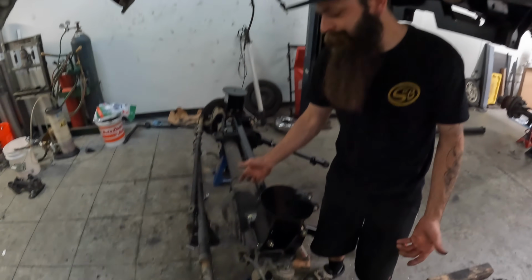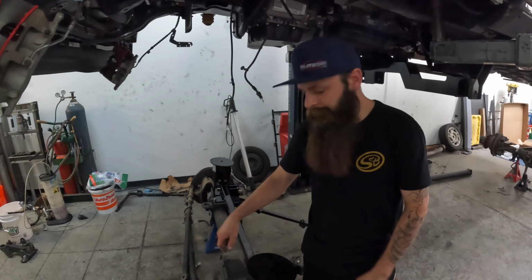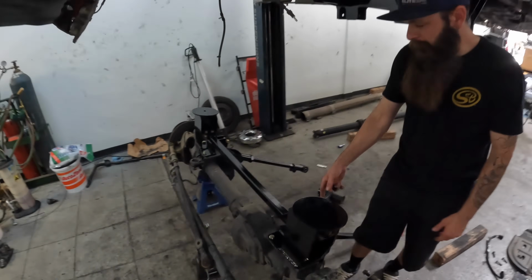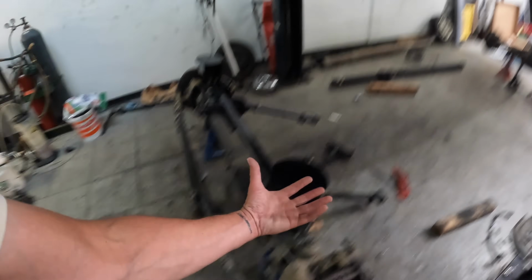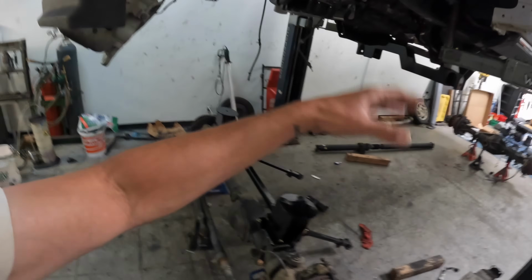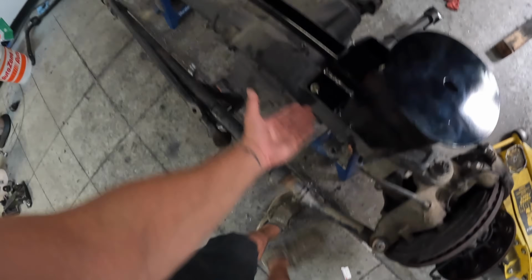Granted, doing the heads, probably not the best idea, but the heads will show you if the bolt's actually been spinning around. Usually, if I can get to the lock side of it, I'll do the nut. A lot of things you don't want to tighten until you get it up into place and everything's squared up, then you tighten things down. This is a good way to know what's been tightened and what has not. Clearly everything onto the axle there has been tightened. These boogers have not.